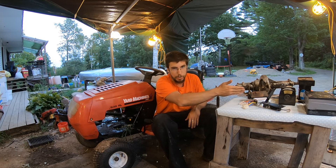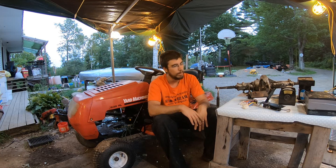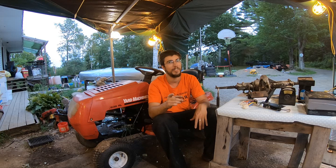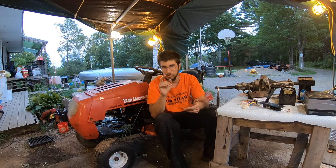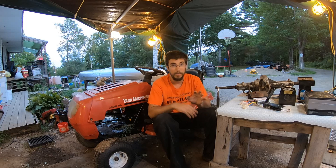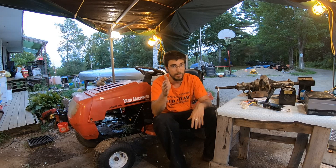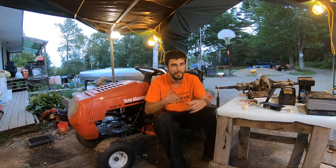They're basically the same concept. The only difference is the electric motor is going this way into what essentially is the brake shaft, instead of going this way into the input. And then I got thinking even further — and that's where the mad science started. We're going to try and take this little MTD, rip it apart, and rebuild it as an electric lawn tractor. If this works, we're going to mount a solar panel on top, and as long as you park it facing south — we'll even put a compass on it — it'll sit there and charge up, and anybody in the family will be able to just jump on, hit a toggle switch, and go. That's the goal.